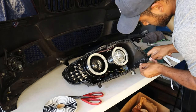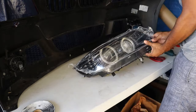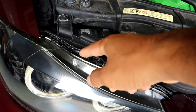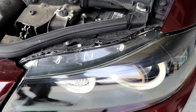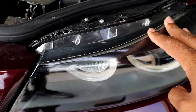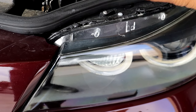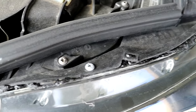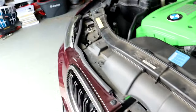And either I didn't do a good job or the sealant just failed over time from getting too hot. I'm assuming that from just heating up and cooling down over time, it just started to separate. But as you can see on this headlight, it does not have that issue because initially the guy who did my retrofit drilled holes for screws to hold the lens and the housing together, and that's played a huge role in keeping this lens together and not separating like that one.